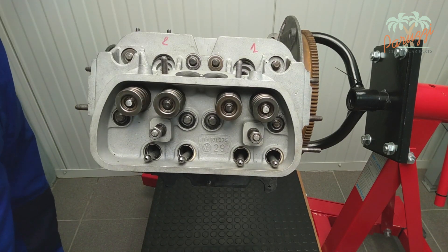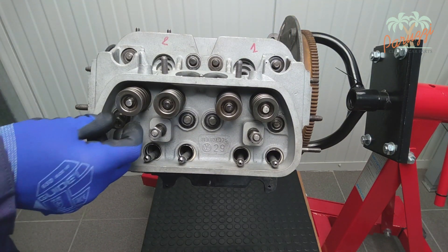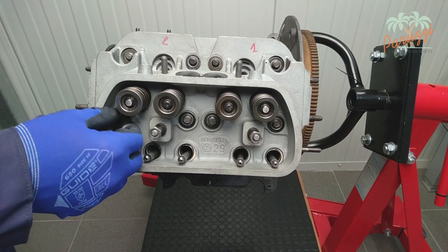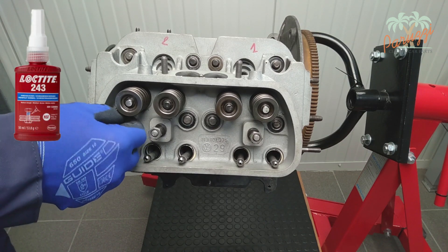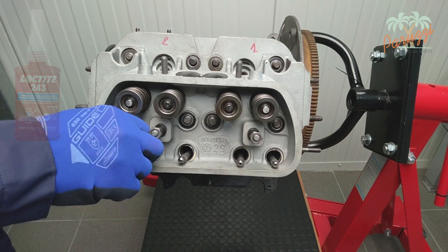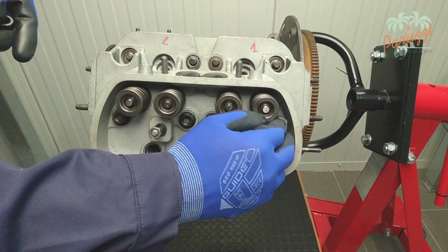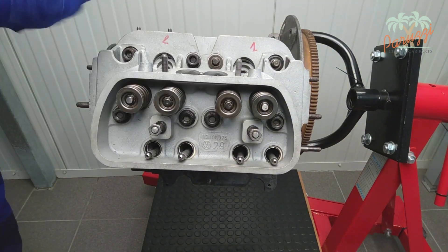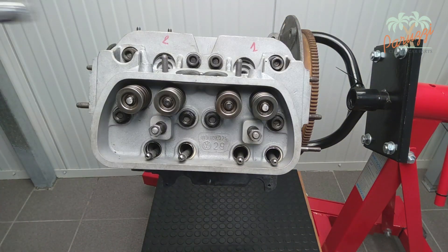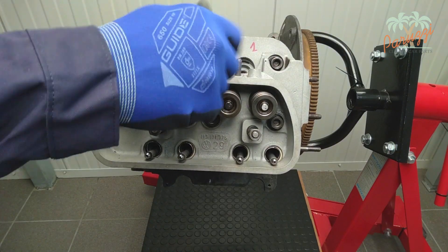Use a light to medium strength locking compound on the threaded rods to give the nuts an extra lock — for example, Loctite 243. Screw the eight nuts onto the case studs, first tightening them by hand until resistance can be felt. The order has little importance at this point. You can use a socket wrench to tighten the eight nuts manually.